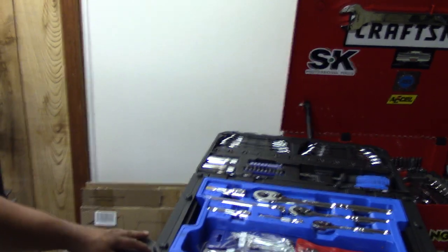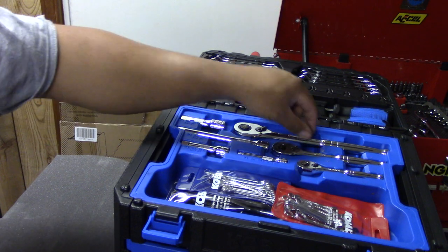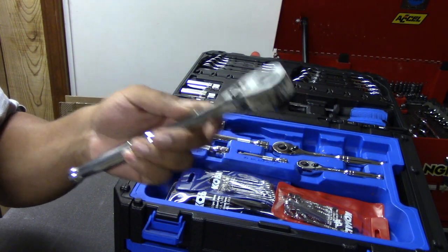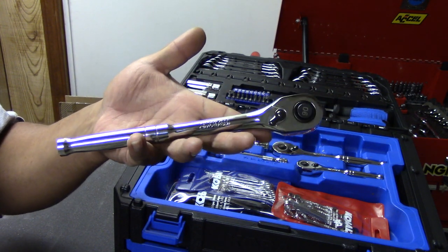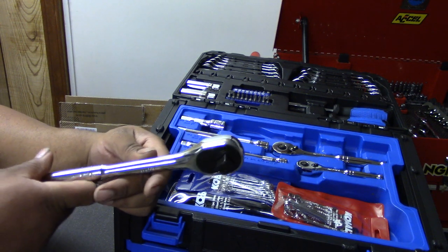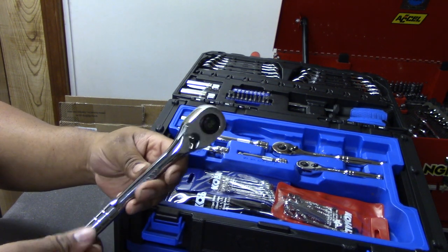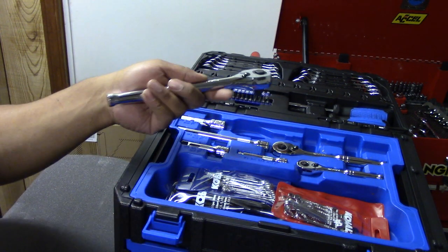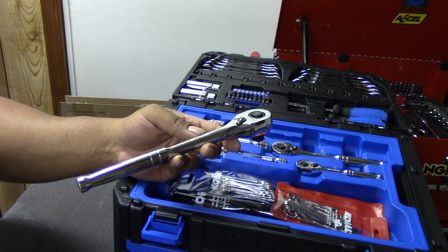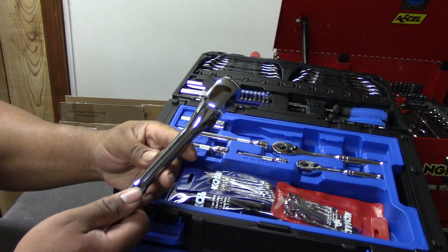On the top side we've got our ratchets. These ratchets will get the job done, but I'll let you know right now you're probably going to want to find a better ratchet pretty soon. This half-inch drive ratchet is probably one of the heaviest I've held for being this small — I don't like it, it's pretty bulky and definitely wouldn't get into tight spaces. For basic brake jobs, suspension work, valve cover gaskets, water pumps, and radiators it should be fine, but definitely no European work or tight-confinement internal engine work.